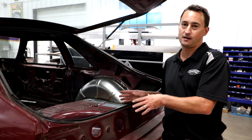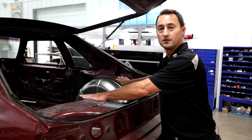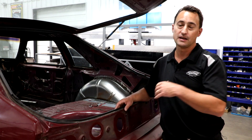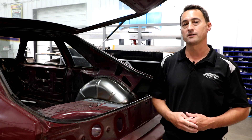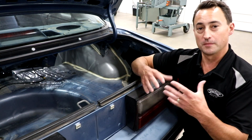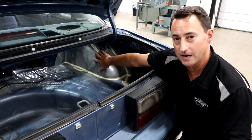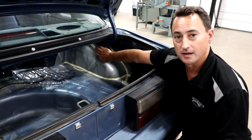As you can see, we finished our Detroit Speed mini tub install on our 89 hatchback car. Now you can put your carpet and padding back in and mock up your interior trim panels so you can see where you need to trim around the new deeper Detroit Speed mini tub. There are some subtle differences with the notchback car, so we're going to walk over to our coupe. We've got the tubs primered and seam sealed. The main difference is we have a trunk, so there is a trunk hinge bracket that you're going to remove from the factory tub, modify it, and graft it back on the mini tub and plug weld it in place.